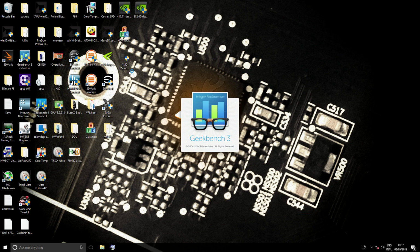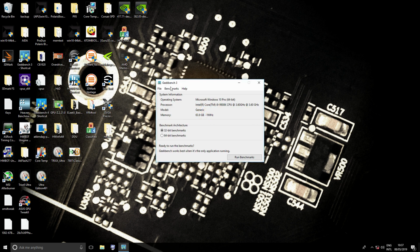Okay, well, let's run Geekbench. I guess we could also try like 1.45 volts and see if the primary timings improve at all. What else is there? That's the thing about memory, there's so many different combinations of things to try. And the other thing is, I don't actually know, the Samsung M-Die, I think, is manufactured on the new smaller nanometer process. So I don't actually know how this stuff will behave at high voltage.